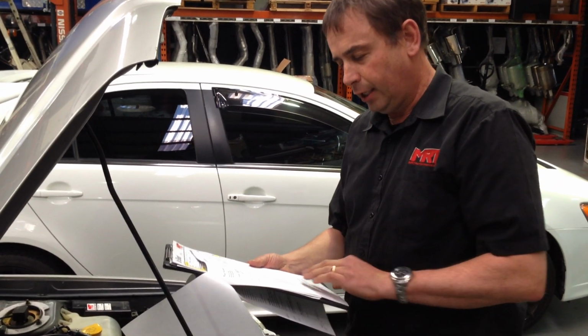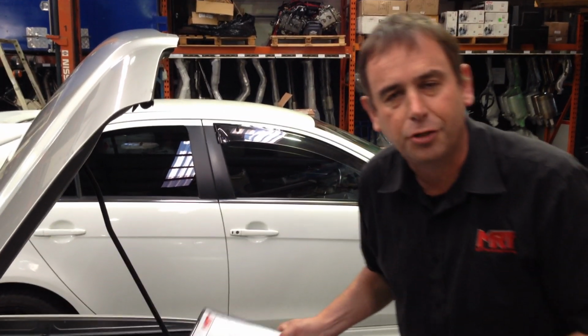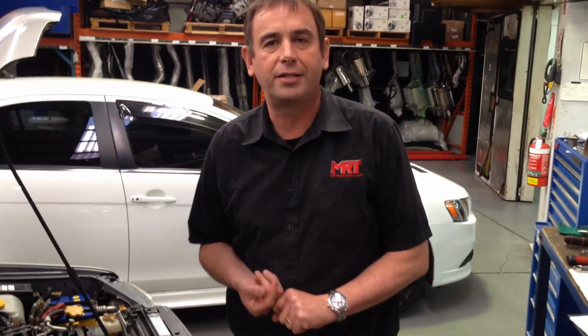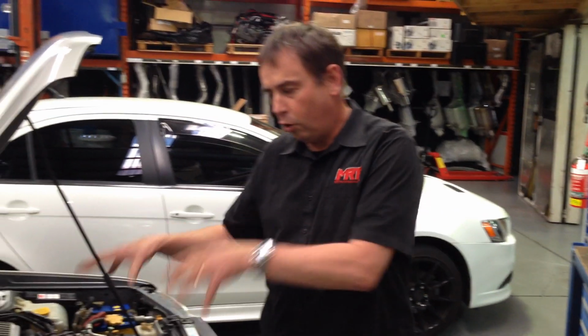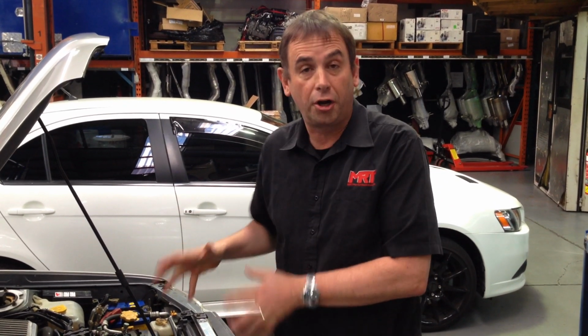And finally, the big thing that we did was custom tune it. Now, a lot of people think that you can't tune the factory ECU on the 99/00 model WRXs and the STIs, or the Forester GTs. Well, you can if you've got the EcuTek tuning software. Some workshops are a bit scared to touch them. We do a lot of them.